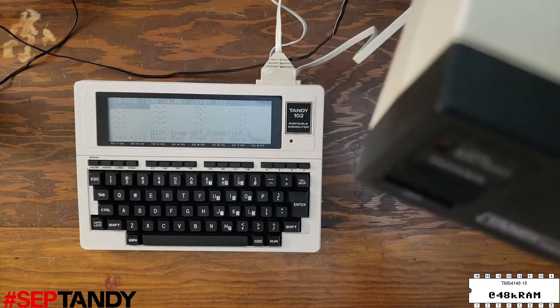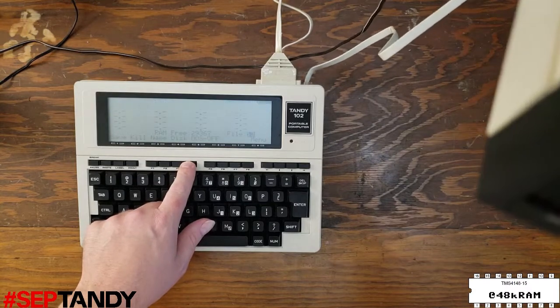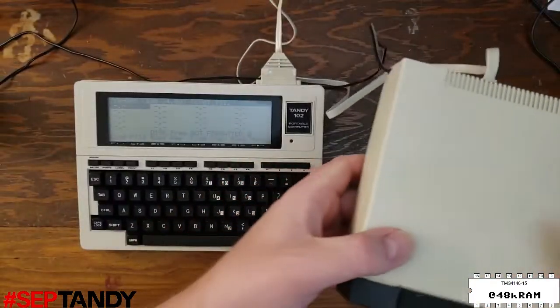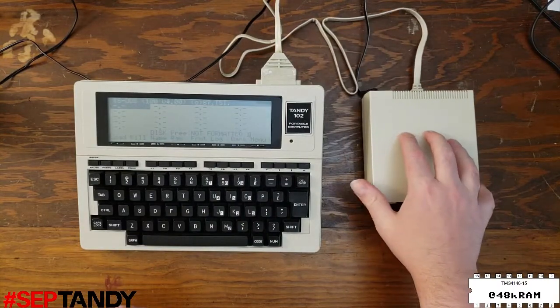that telltale sound right there is the sound of a drive motor spinning, but completely uncoupled to the disk mechanism. And you can hear it again. So definitely we need to get in there and get this belt replaced. Like I said, this is exactly what I was expecting to find.